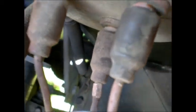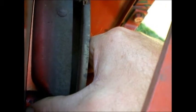Also, I already took the bolts out of here, but let's just show you. Once you have the hood up, a lot of times you can just put your hand in here like this and hold that rubber, and it's just enough after you've put the penetrating oil on the threads on this other side. It's just enough to hold that still so when you take the ratchet to it, it'll break free and you can hold it from spinning and you'll get the nut off. If you do have to get into it, you have to take off 2 bolts. There's a spring on here, but you can flop it over and then you can get into the actual bolts on these. There's a bolt, a nut on this side as well, and you can grab a hold of that and get that out and do it that way if you have to.